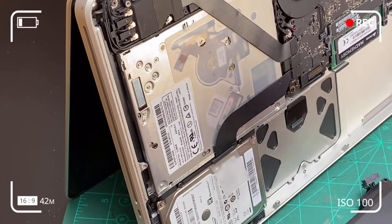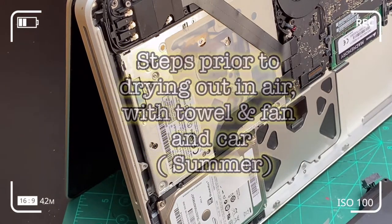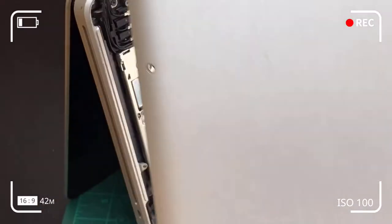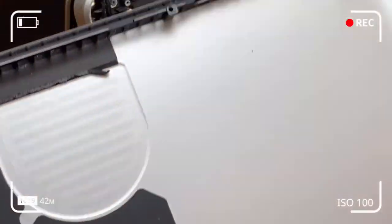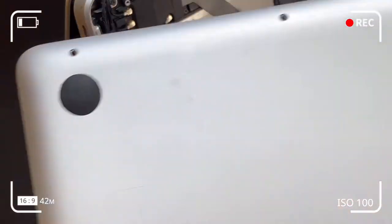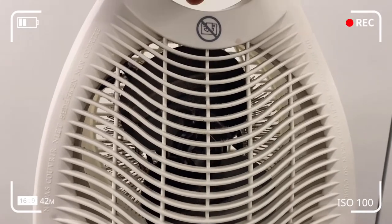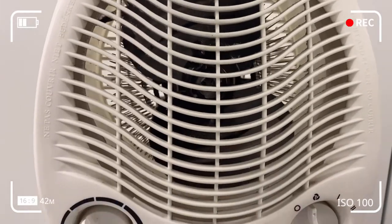When I opened the computer, I still found water on the inside, which I dried out with a towel. I also used a fan placed just behind the computer to dry the motherboard out. Do not use the heating setting on the fan, as this could cause static — instead, use the normal fan setting.